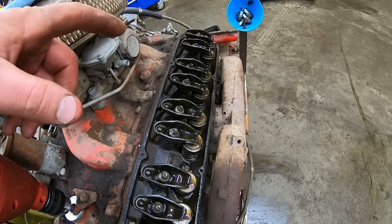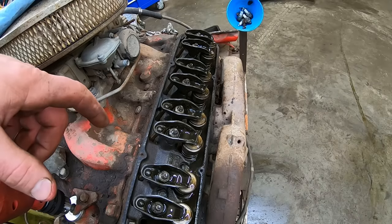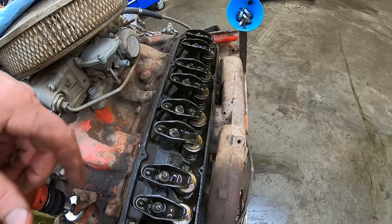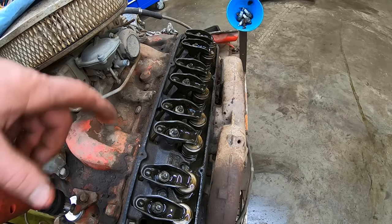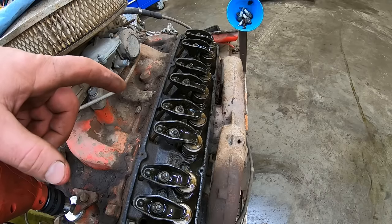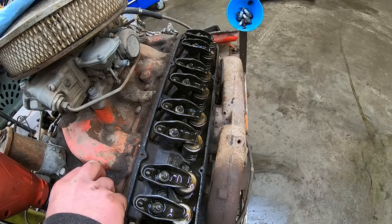You can hear a valve snap, and I don't know which one it was, but we'll throw a distributor in it, and then we'll find a starter, start cranking it over and see if we got compression in every cylinder, and all the valves look like they're doing valve things. And then we'll be ready to do the spark and fuel thing. We got oil, so that's good. You don't want to fire them dry.